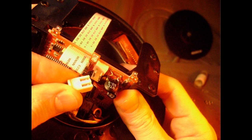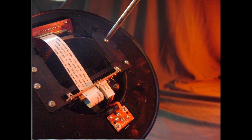Now just reconnect the plug wire and be sure that it is locked securely in place. Connect the data ribbon cable leading to the front LCD panel and press those little brown locking tabs into place. The next step is to tighten the screws of the center mold to the base of the machine, but obviously the center mold needs to be flush against the bottom base of the unit, right?